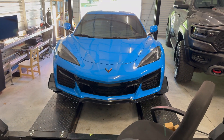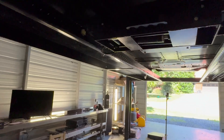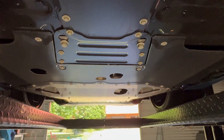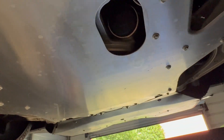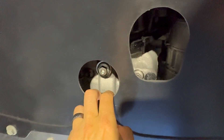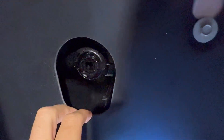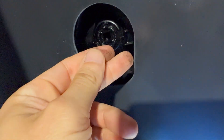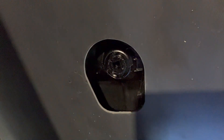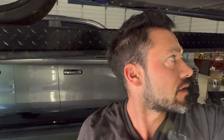Here's our Corvette up on the lift. We've got basically three drain points. Here's your filter — this is the back of the car, it's a 32-millimeter. Right here we've got a really nice factory drain plug, that's 15-millimeter. And then there's the quarter-turn plastic plug. So those are our three spots that we're going to drain, and then we go from there. Pretty easy — we'll pop those off, get some oil in it, reset it, and send the oil off for analysis.